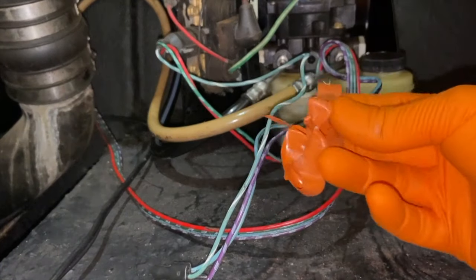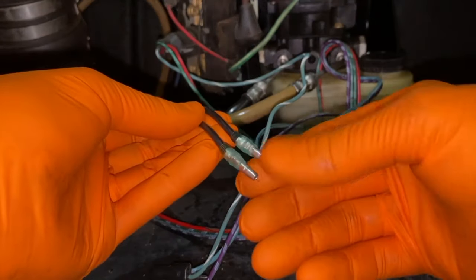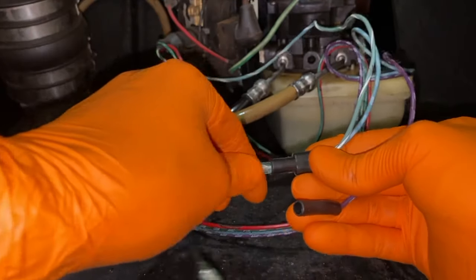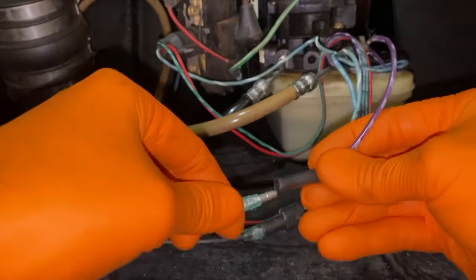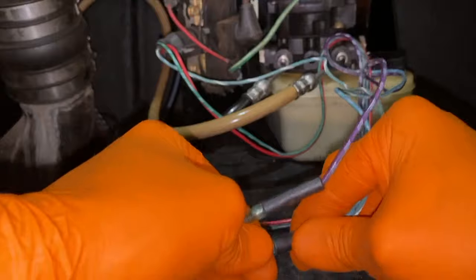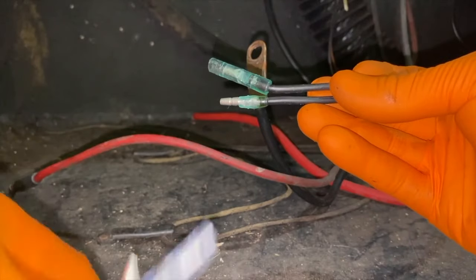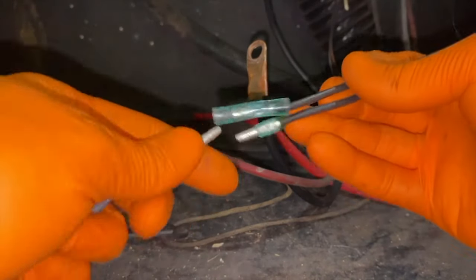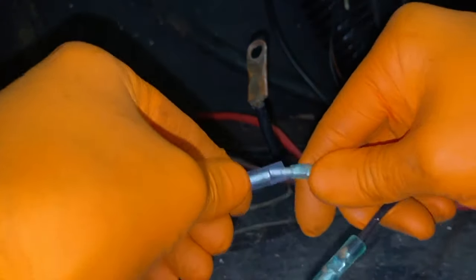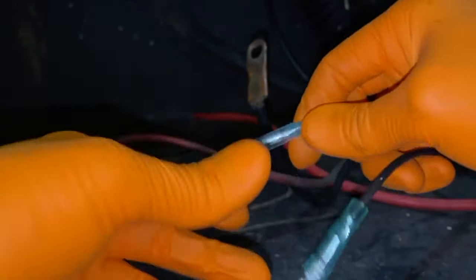Back inside the boat to the port side — I have removed the orange electrical tape used to pull the trim limit wiring through. Per our service manual, it does not matter which connection goes into which fitting, but you want them secured — they should make a clicking sound. Now to the starboard side trim sender wiring — I removed the white electrical tape. This is where the fittings or adapters come into play. Secure the first one into place — it should make a clicking feeling or sound — then the second one. Really push them in there but don't damage them.